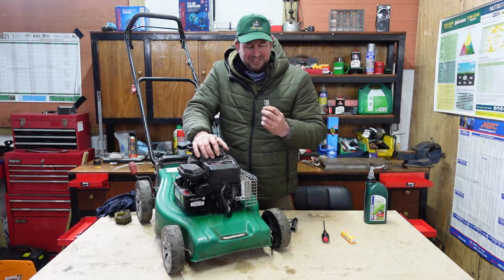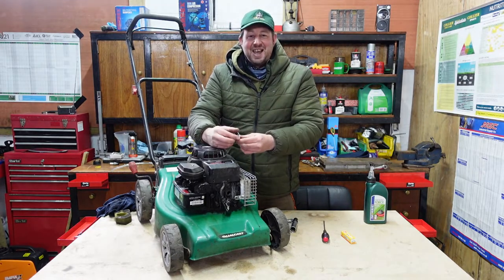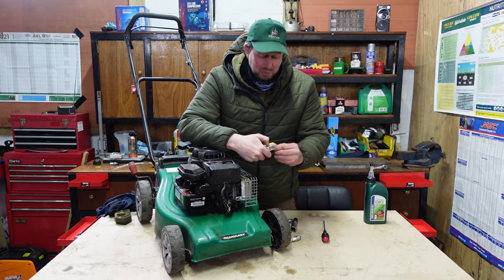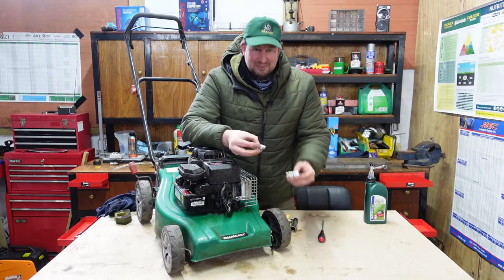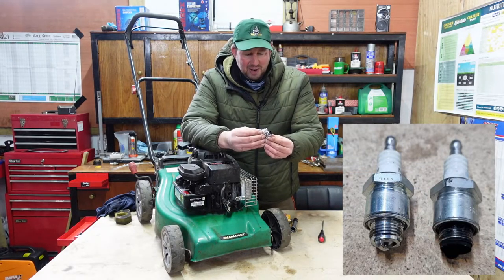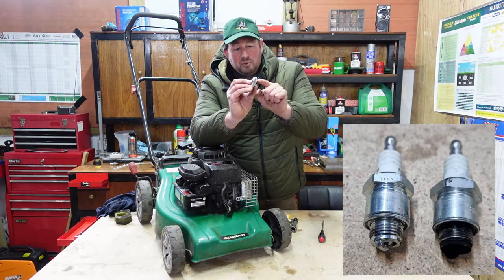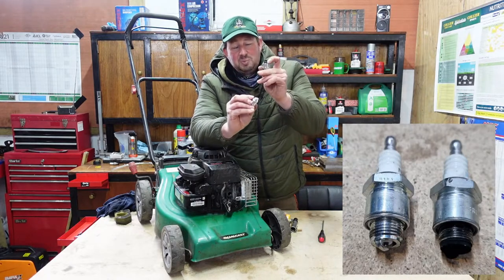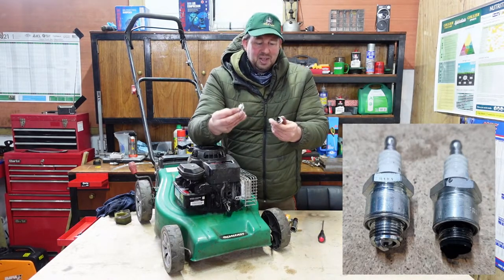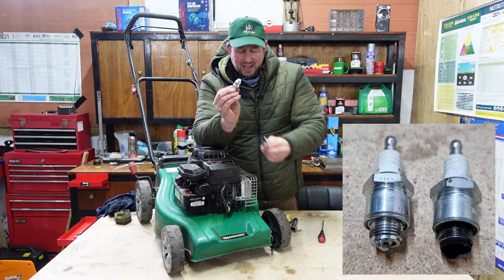Let's take this out — oh dear. That's dirtier than the air filter! I didn't think that would be possible, but that's dirtier than the air filter. Let's have a little look at our new spark plug and see how that compares. I'll just put them side by side to make sure they're alright — regardless of numbers on the box, you just match them up. The washer on the new one will always be a little bit thicker because it's a compression washer and that's what forms your seal. Once this has been in and tightened up, it squashes that washer down. You can certainly see the difference — absolutely filthy versus nice and clean.